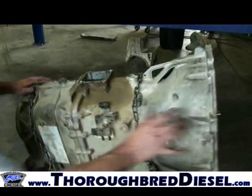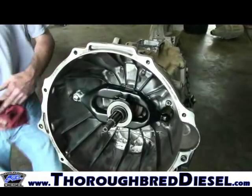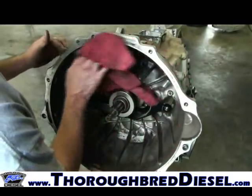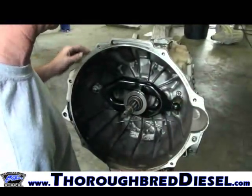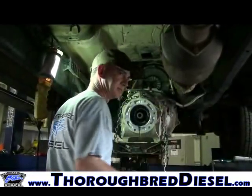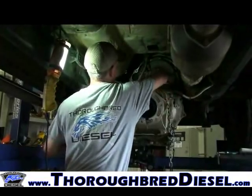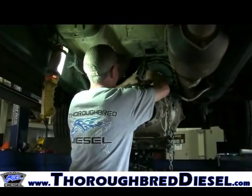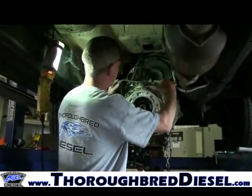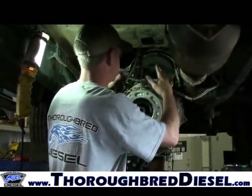The transmission is prepped and filled. No grease on the clutch or input shaft splines. Do one more once-over on your throwout bearing and double check everything before you go back — this is a one-and-done deal; you don't want to pull the transmission back out over something silly. When starting back up with the transmission, take a rag and put it on top of the transmission case so you don't get any dirt inside. The wiring loom that goes to your DPF controls will go underneath the transmission as you're coming up.